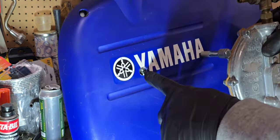So before, I was having problems with the engine actually running too rich because there was still gasoline inside the carburetor bowl, because before I was recording the video, I was running it exclusively on gasoline to make sure there were no problems before I reinstalled the motor snorkel for propane operation. And that's why I had this all the way in and it was still running. Once that residual gasoline burned off, it actually died out. That's when I had to stop the video. Restarted it, got it to about 3 to 4 threads here, and now it's running excellent.